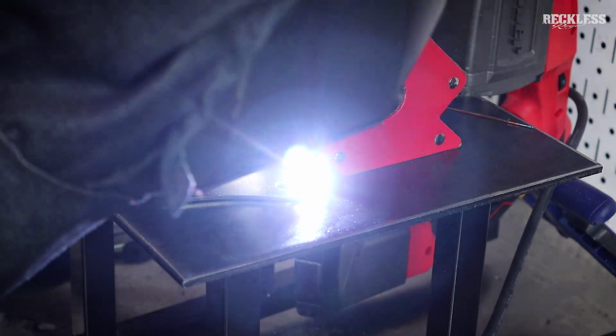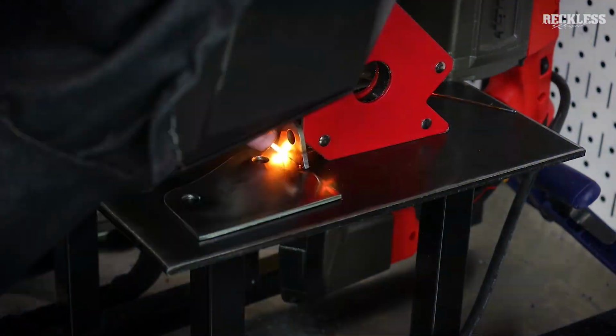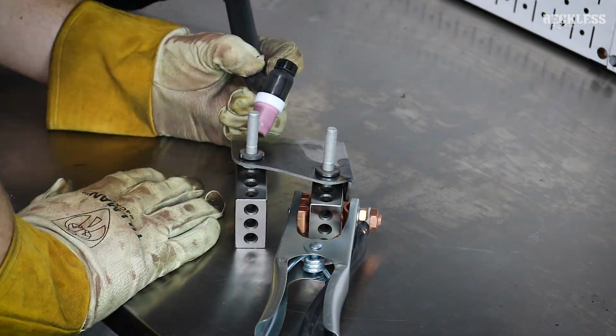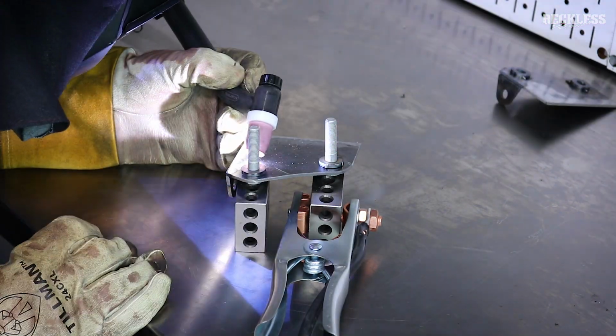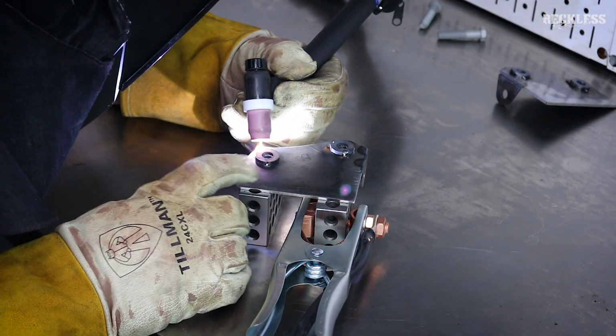These are just a couple tabs that I had laying around, but they make it a lot easier when you're installing or moving the engine. You can remove the hardware and the motor plate, mid plate will just sit on this tab. That way you don't have to have it hooked up to a hoist the entire time. And then I have the reinforcement washers from the piece that I bought that didn't work, so I decided, well, we'll just use them since we have them.